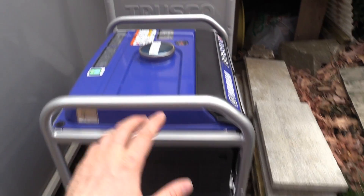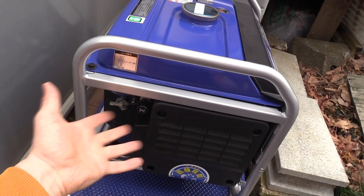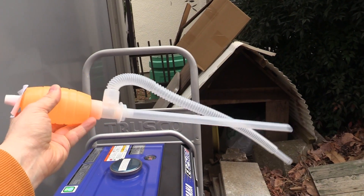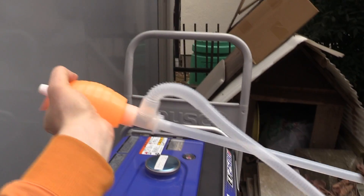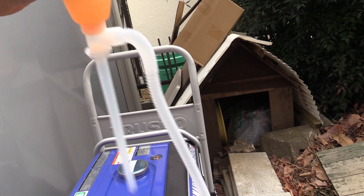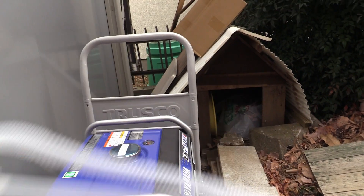The next thing is pull the fuel out of the tank. If you're lucky you might have a drain somewhere. If not, you just have to use a siphon or a pump. In Japan we've got these hand pumps - you might have something similar in your country. It's just a hand pump with a squishy bit at the top that sucks in through the rigid pipe and out through the flexible pipe. Stick that in, pump out into the jerry can, and then you can use the fuel in the car before it goes bad.